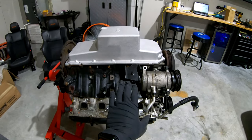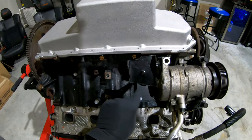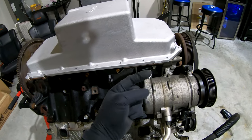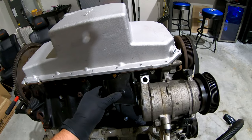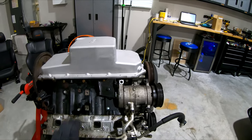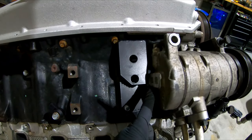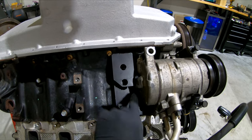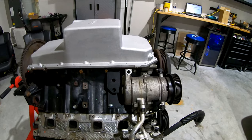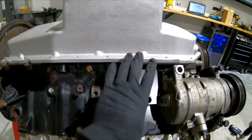Here's what the motor mount looks on — that's what it's actually going to look like, but this doesn't have a nut on it yet. You see how it's angled and cut — that's how it works. The nut end goes toward the front of the engine, so the bolt goes through this way and you tighten it up. You have one, two, three bolts that hold the compressor on, so we're good there. I trimmed it as close as I could and it was perfect — gives me enough room for the mount to clear. The mount's tight.